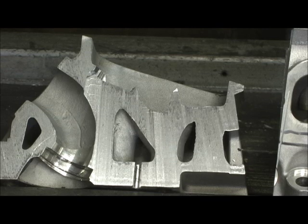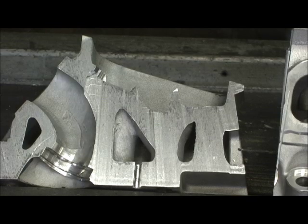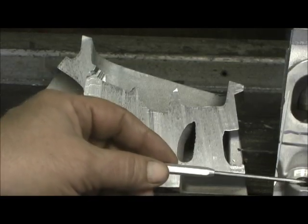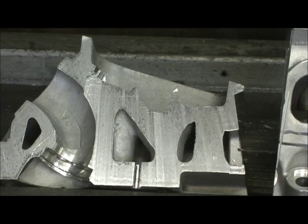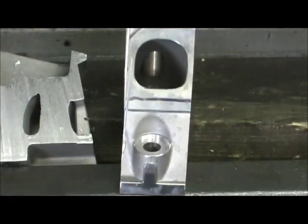And once again, this is an area of serious modification. As far as the head going up to a straight max effort stage 4, they've given us plenty of meat. Kept us thick on the deck. Look at the deck surface. We're going to get to that in a minute. But I wanted to show you the exhaust port, how far she is from the... we'll take a look at this here. This is kind of an indicator of what you got.